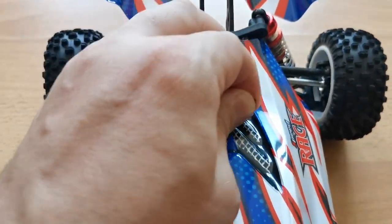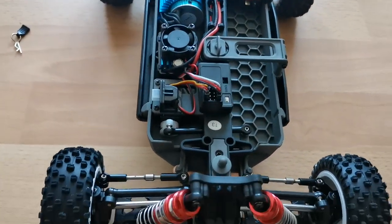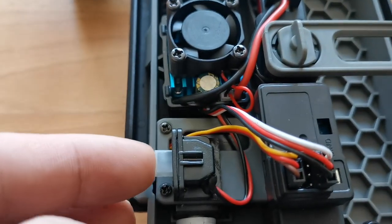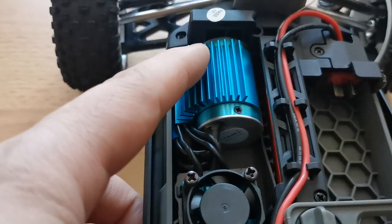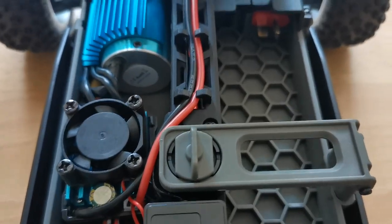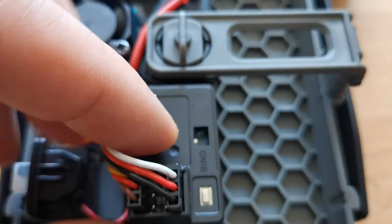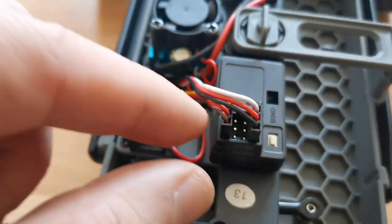Let's see what's under the hood — it looks quite tidy. The first thing I notice is the fan on the 35A ESC. There's some water protection going on as indicated by the rubber on the on/off switch. A 3500KV 3S motor with a heatsink. The Deans connector is held in by a screw so you can easily shove the battery on top of it. I also see some free sockets where you can probably run your lights or another fan.